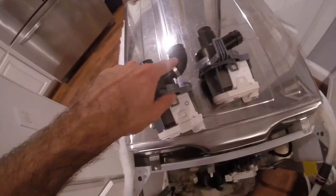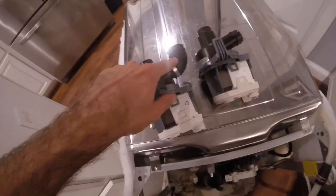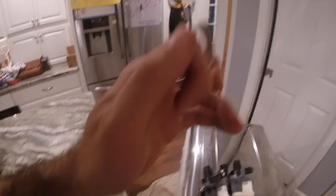You're going to reuse this rubber grommet from the old one, and you'll see that this piece comes on the new one already clamped on the inlet tube. This connector here — this 90-degree bend is there. Slide off this clamp. If you don't have the expensive PEX clamp — you need certain pliers in order to tighten and loosen it — so what we're going to do is use a simple worm gear clamp up top here.